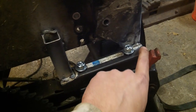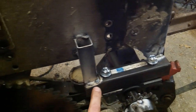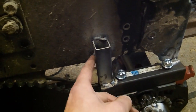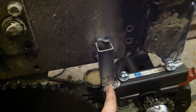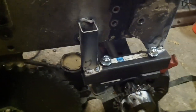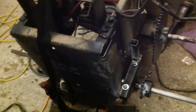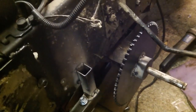I welded the plate across here and I welded it across the backside, and then I came forward and welded this piece directly to the side of the chassis and to the top down here. As you can see it doesn't move at all. I did the same thing on the other side and gears are also welded up on that side, ready to start figuring out chain.